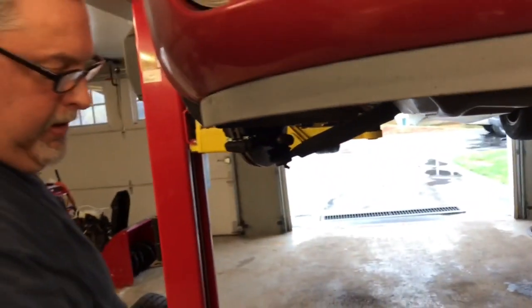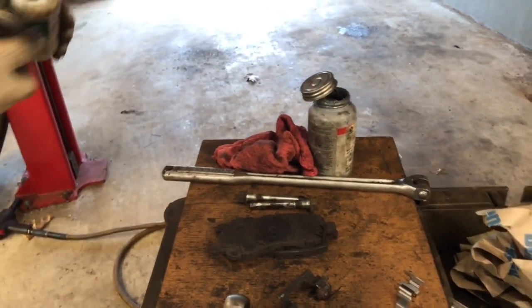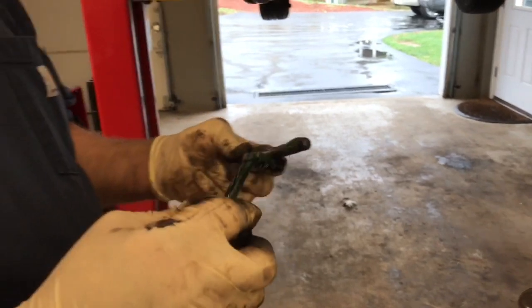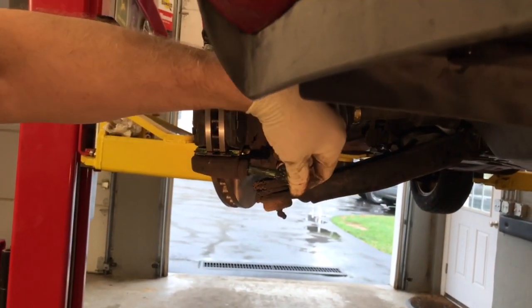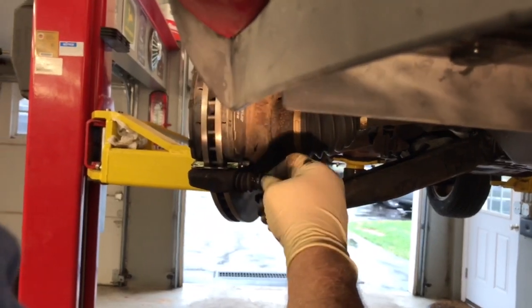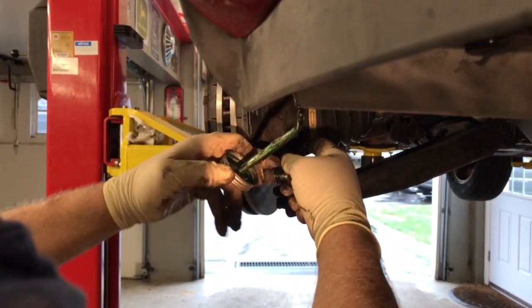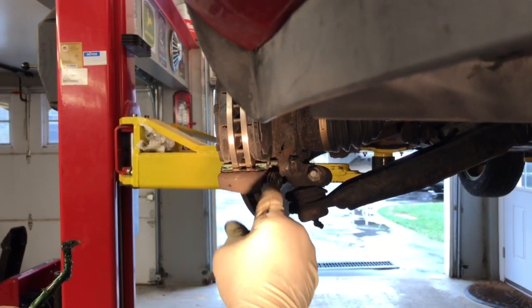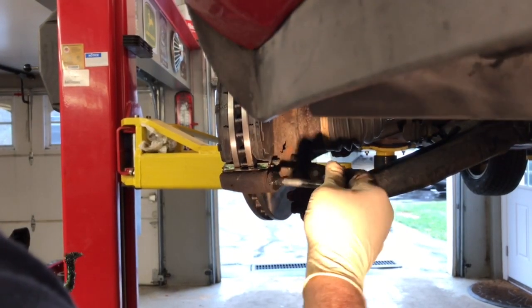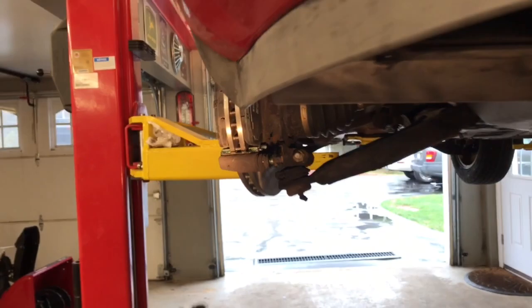Remember our caliper pin — the one with the rubber tip was on the bottom. Get these caliper pins all lubed up before throwing the caliper back on. Stick them in and run them through — you get a little extra grease that pops out. Run your finger across it, then fill the boot with that grease and force it down inside the pocket. You want to just load these things up.